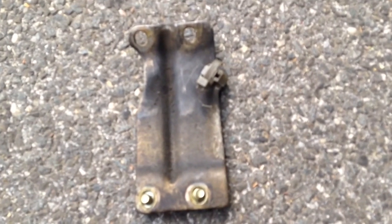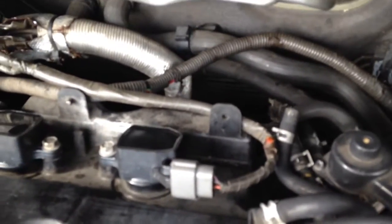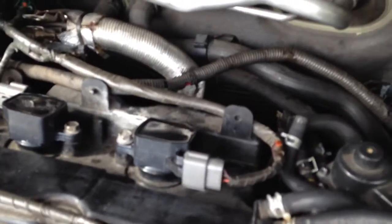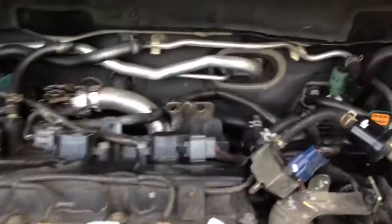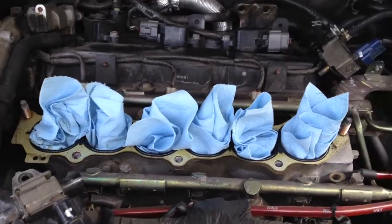That's what it looks like out. There we go. Clearance free. If you got your NWP spacing kit, that's what you need to do. Please make sure you do it before you even get to any other step. Once you get the intake manifold off, that right there will be the bane of your existence if you think you can pass that step, not get it off, and then put everything else on. So definitely that's what it is. When you do put your intake manifold back on, it'll secure in properly and sit properly.